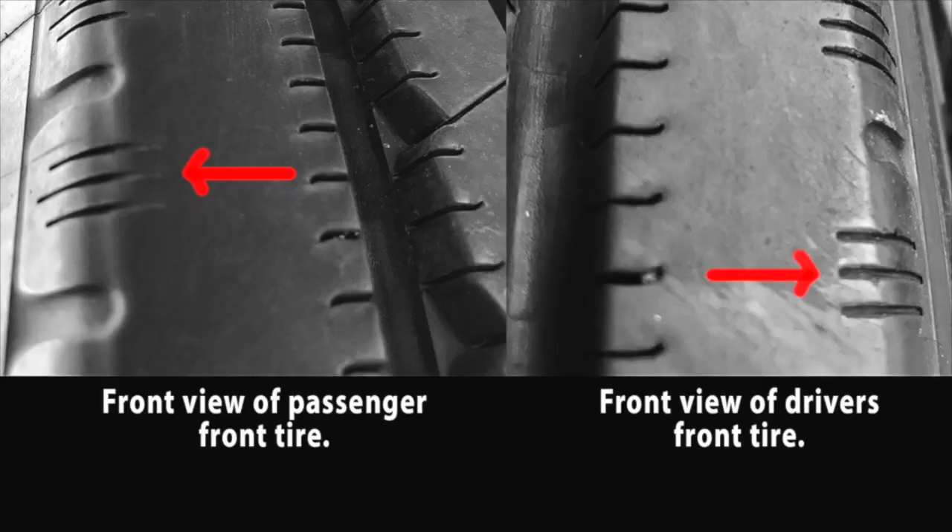After 3,300 miles, we were in a campground in Florida and, like normal, I got on my creeper — I do that every couple of weeks, crawling underneath the chassis looking for things, making sure everything's good. I noticed on my front tires, in this side-by-side comparison, both front tires were wearing on the outside edges. The passenger tire was wearing a little more than the driver's side, but both were wearing pretty evenly in the center and on the inside. I knew an alignment was in order.